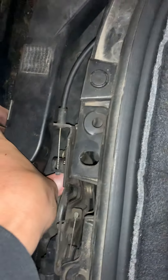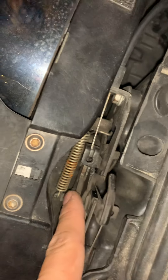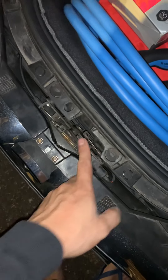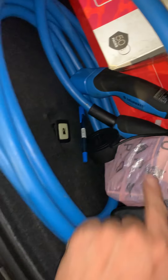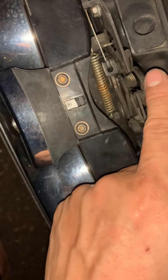So I push down the latch, and you can see as the primary latch is engaged, the secondary latch will also engage itself. Your striker will be hooked by the primary latch, and at the same time the secondary latch is also in action — this is an extra safety feature. When your car is driving and if something accidentally hits the button here, the front emergency release button, the primary latch will get unlatched. But the secondary latch will not let go if you are driving. This is a safety feature designed by Tesla.